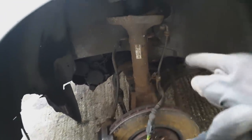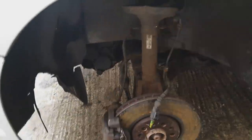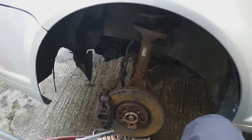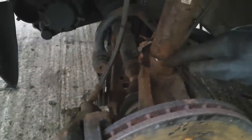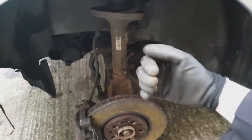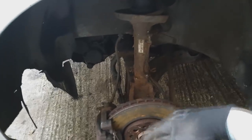I'll take the nut off, then tap that bolt out, and then it should come out as one piece — that's the plan anyway. The bolt is out — it was an 18mm nut and 19mm bolt. The top bolt up there was 21mm. Now the hub is hugging the strut very tightly, so I'm hammering it hard to try and free it. I might need to get a pry bar in the back — it's a split joint that compresses around the tube. If I get a chisel in the back to pry it out a bit, that might help.